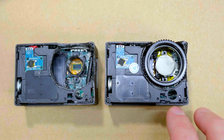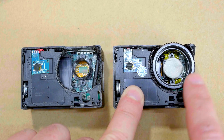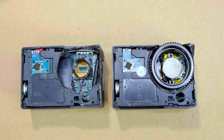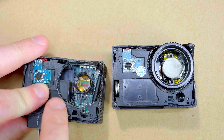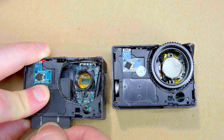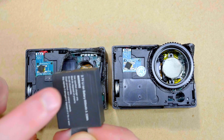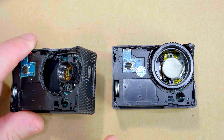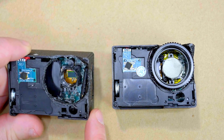I don't want the back of the lens to be contacting that. It's easy to move lenses further away from the sensor if necessary by adding spacers or even a secondary extension tube. But once the mount is permanently installed, it's impossible to get the lenses any closer to the sensor. One downside you should be aware of is that the battery interferes with where the lens mount will be placed, so we can no longer use internal batteries in these cameras. But for my purposes that's fine — for time-lapse, these just don't have enough capacity anyway. You can power these cameras instead through the USB port on the side, either with an external battery pack or a wall outlet. Using a cell phone adapter and USB cable, you can run these cameras indefinitely.